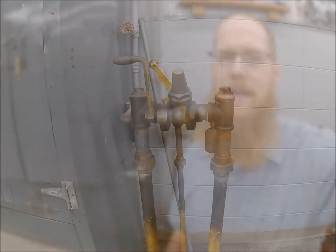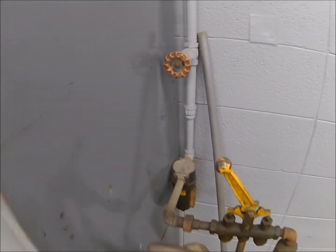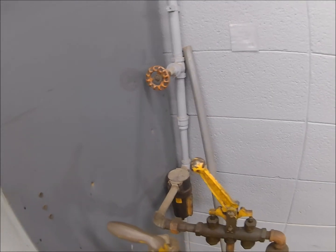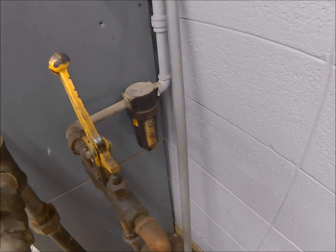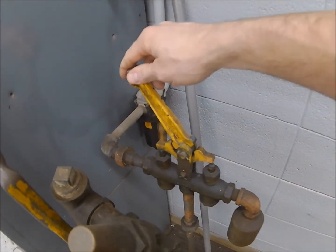I'm a single man show here, so I'm going to try to do this as quickly and efficiently as possible. I'm going to put you on tripod and show you the controls. Coming out of the wall right up here, I have an air valve that I've got to turn on before I do any lifting — that's the supply for my main compressor. Back here it goes through an air filter to get out any excess moisture and condensation.